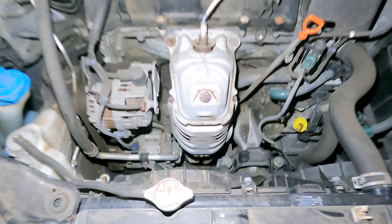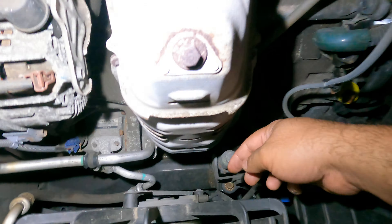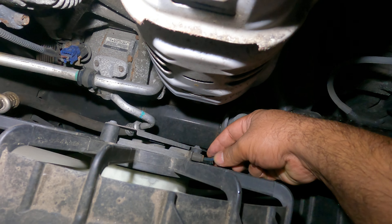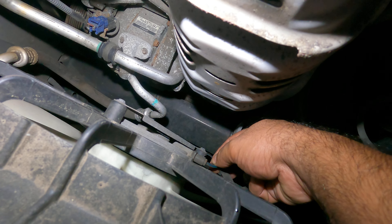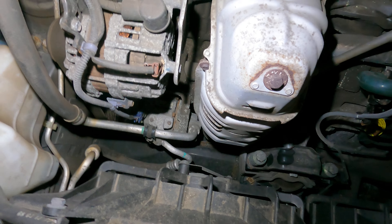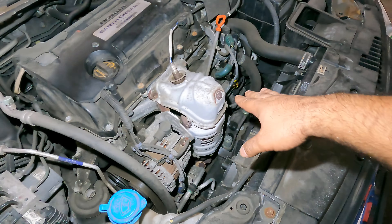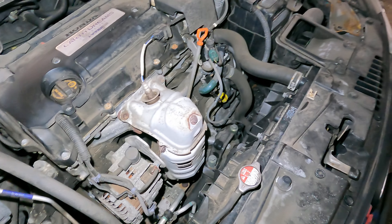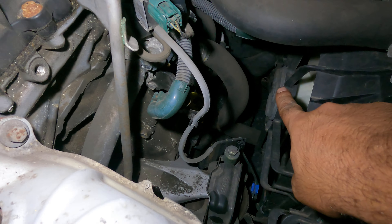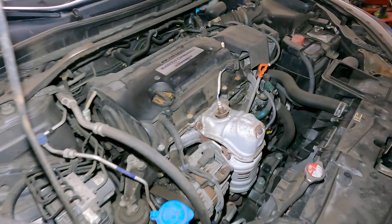One last thing: if you let the car run and put the AC on, both fans should come on. If they don't, you need to check power and ground. You see this blue cable here and a green one — one should be positive, the other negative. Take your test light and check that. The AC has to be on to command them. Be careful of the belt and the heat of the catalytic converter. You can remove this little bracket for better access — there's another connector on that main fan too.